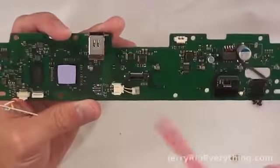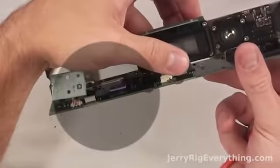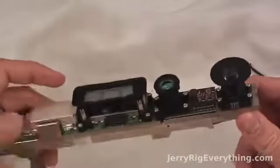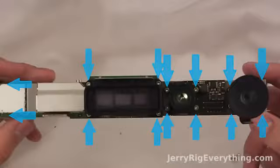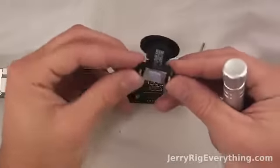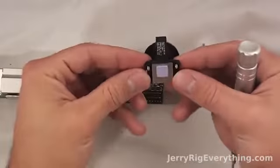And I found it interesting that they had like a foam covering over the processor. So instead of using thermal paste, they had like a thermal foam that connects the motherboard to the heatsink. And the heatsink is massive. So right here, you're going to see a bunch more screws that hold each individual component onto the heatsink itself. And each one of those, so here's the main camera with its own little thermal foam attached to it.